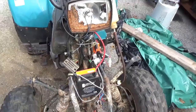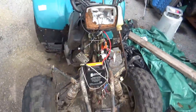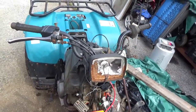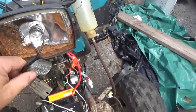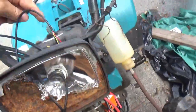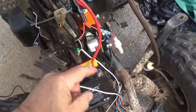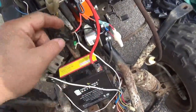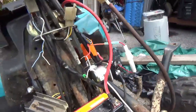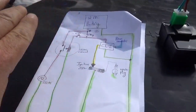There's one additional thing I personally like to do. Right now if I leave it on it's just going to stay on — you've got hot things — and when you're wiring something up for the first time you don't want any surprises, so you'd like some kind of indicator. When the key switch is on, this is where the power is going to power up the entire bike. So I'm going to hook this light up to that because I want to be able to keep track of when I left the power on.